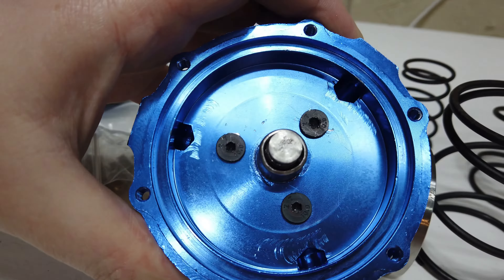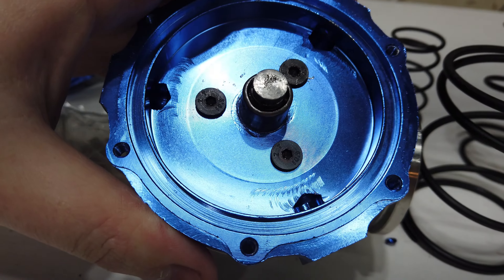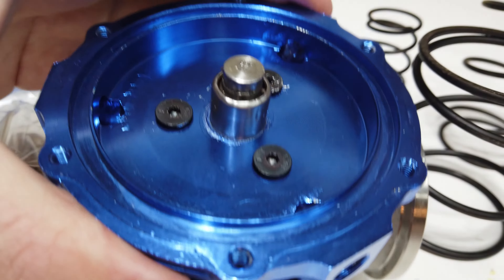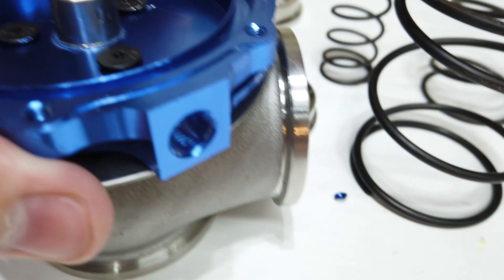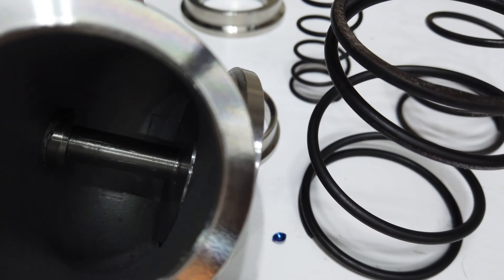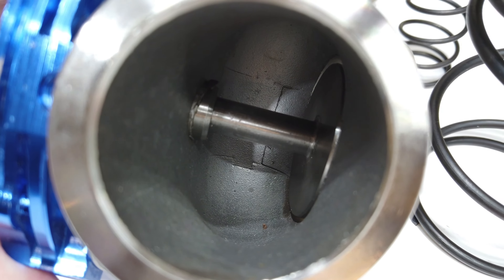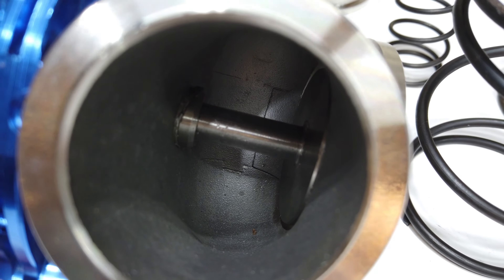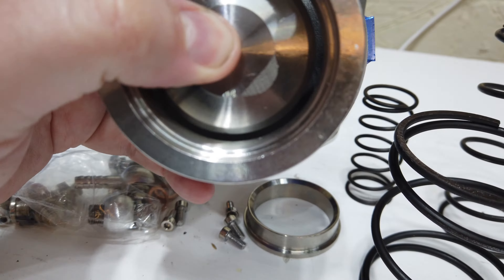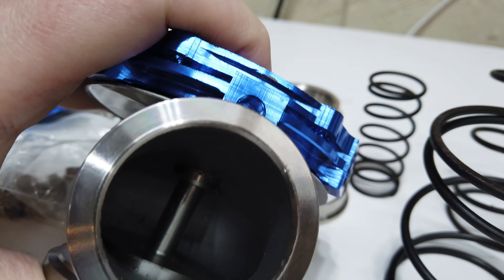With the diaphragm removed we can see the top of the wastegate with the screw. I've readjusted it to get it to sit flatter - still not perfect. I'm not going to use this valve; I'm actually going to ask for a refund. There's also a bit of blue metal that fell off from inside, and looking inside the valve you can see a big chunk of aluminium or steel swarf in the housing. Even after dismantling it, the valve isn't easy to push - it feels gravelly almost. The workmanship is poor.